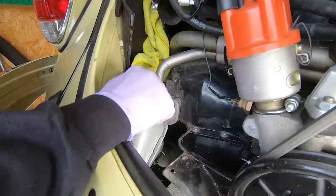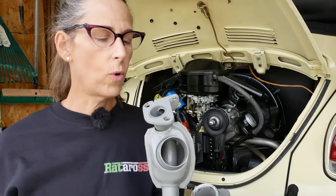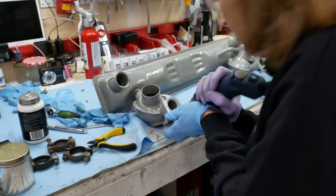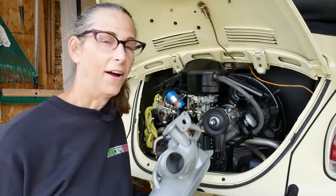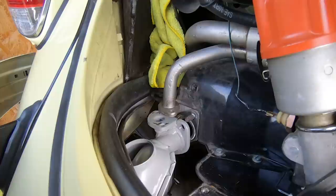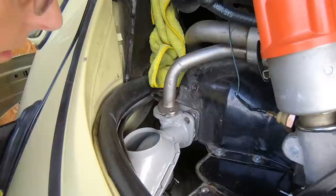Now our only trick is going to be to get the gasket underneath this thing, and it's rather thick. It's close but still not quite there. I think the biggest problem is the bottom one — I need to go up diagonally a little more. The top one doesn't have a lot of material left. I'll try to widen that up a bit as well. I can kind of get the muffler on but there's no way to get the gasket on top. Let me continue grinding a bit. I'm hoping that the 18th time's the charm — those holes are pretty oblong at this point.